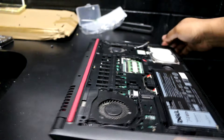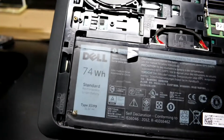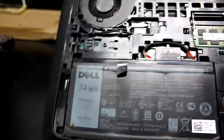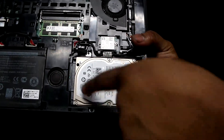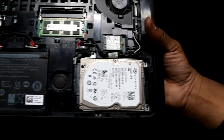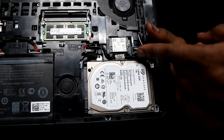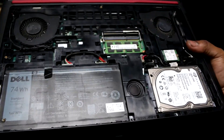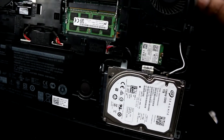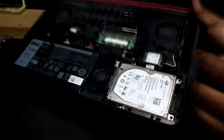This is what it looks like when everything is wired back into position. The battery cable is plugged in and there are five bolts holding the battery in — they're all the same size. The hard drive is in and plugged in with four screws. Here's the LAN chip — white goes on top, black goes on the bottom. The RAM chip is in, and all the wires are routed exactly how they were from the beginning. Here's the LCD cable, the power brick cable, and the Wi-Fi chip cable, all in position.